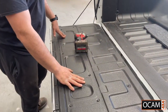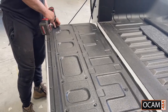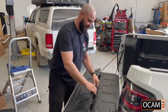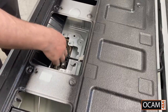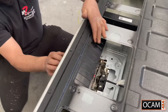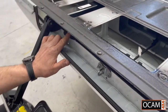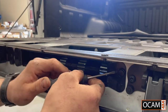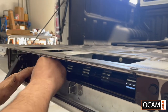We're going to start by taking off the rear panel. We've got some Phillips head screws — take them off. The panel comes straight off. We've got this plastic to undo the rear. Have a look through here — there's two clips holding the whole shroud in there, so we'll take these clips out. Just put a flathead screwdriver in and give it a bit of a pry; that pops out on both sides.